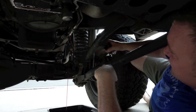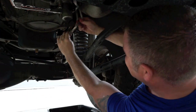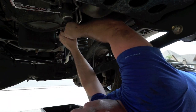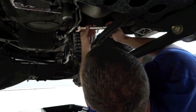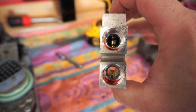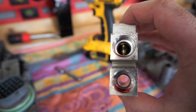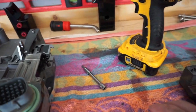Before I lose too much fluid, I'm gonna get this new one in. Thermal bypass, and as you guys can see in there, there's that spring right there, that thermostat. Once your trans fluid gets to a predetermined temperature, that'll open. If that fails, your trans is pretty much just going to burn itself up. So that's why they make these little bypass blocks,